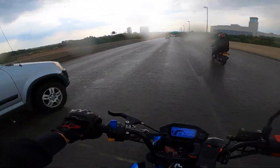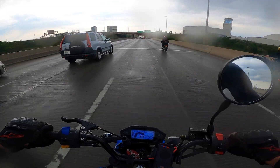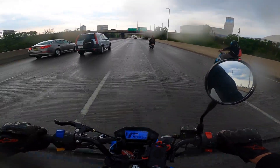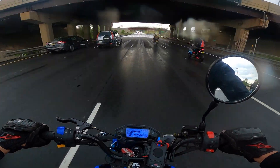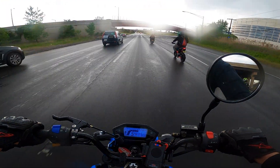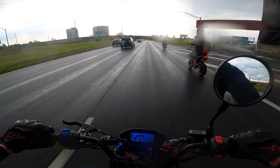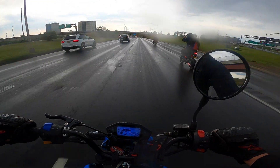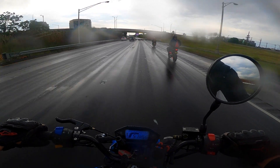All right, I'm going to stop talking because I'm about to get drenched. I'm just going to try and figure out how to get home without freezing my ass off and make sure I make it back alive. Thanks for watching, guys — hopefully that lets you know you can drive on the highway on a Boom Vader or Grom clone, whatever you prefer. It is doable. Change out the sprockets if need be — upgrade your front sprocket to a 17 tooth if it's a 15 — and you are good to go. See you guys in the next one, peace.